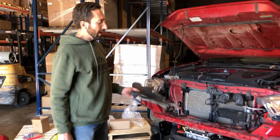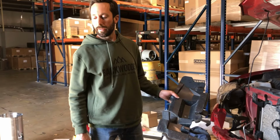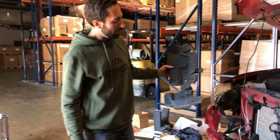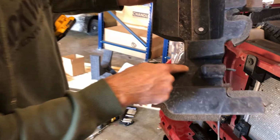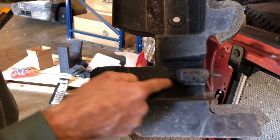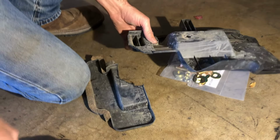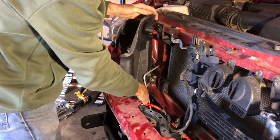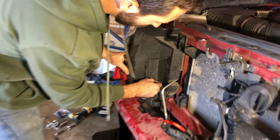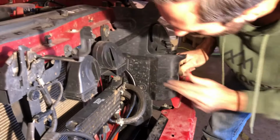Okay, so we finished the cut, the test fit of the plastic. We may have to touch that up one more time, but now we're ready to install the bumper. And earlier we said we'll probably trim these splash guards, and that's going to be the case. Right through here below this last clip, we'll just trim the bottom part off. And then just repeat on the other side.